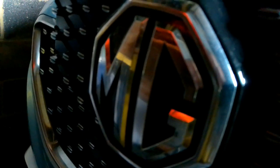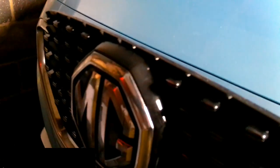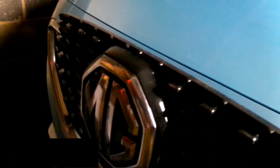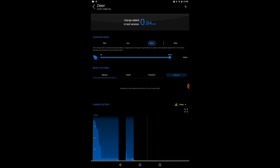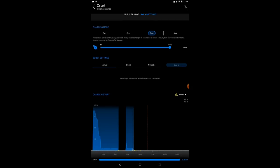I've now got a blue light back on the charger. According to the charger screen it put in 0.84 kilowatt hours after kicking back in, and the MG badge has gone out, so the second balance didn't take too long. I was a little surprised it started charging again at 8:30 — I would have expected the battery management system to tell the charger no more power was needed if the battery was at 100% and fully balanced after the first 8 hours. But it did stay on and do another 2 hours of balancing. It now looks fully balanced, so let's unplug.